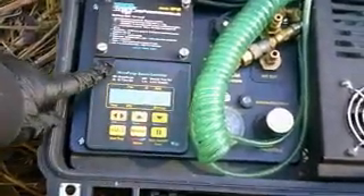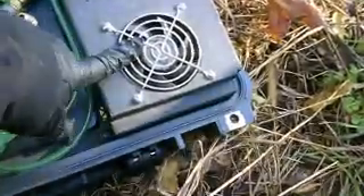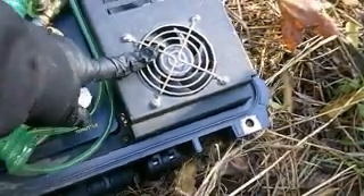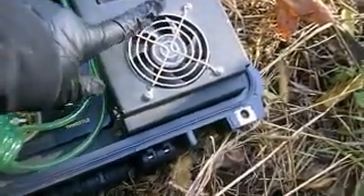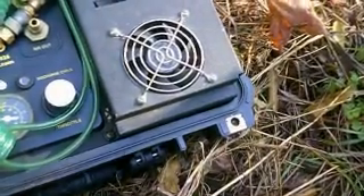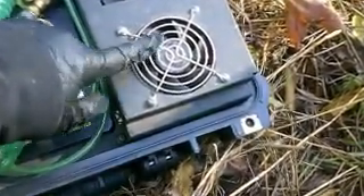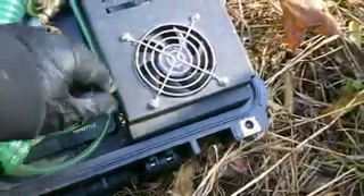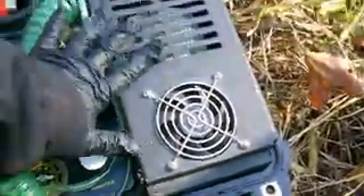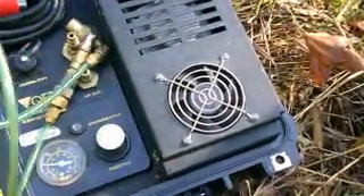This is the MP50 setup — this is the controller part. This area over here is the compressor. It's got a fan. If this fan is not operating and it's too hot outside, it's possible you have your positive and negative terminals on your car battery set up wrong. Sometimes if you flip-flop them, it won't run at all, or it may run for a bit then stop and the compressor will overheat. So just make sure you're paying attention to that.